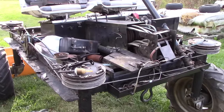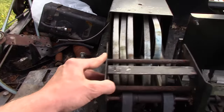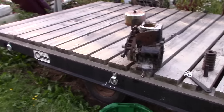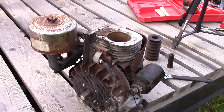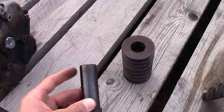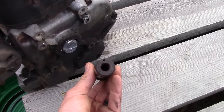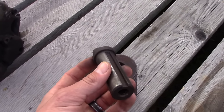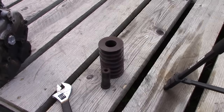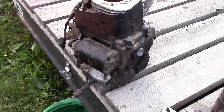Fast forward a couple days - you can see I've been busy at work on the quadractor. The engine has been liberated from the chassis and it's littered with mounting bolts and clutch assembly parts. The clutch assembly is dangling with six belts for the drive system. The engine had to come off because I think it's basically junk. I needed to get this drive pulley off, but I could not remove it for the life of me. I took it to a shop and they ended up torching the output shaft right off the engine - just blammo. They still had to set it on an anvil and drive it with a steel spike and an eight-pound sledge, one guy giving it all he had, quite a few strikes to get it free. It's unfortunate the output shaft got torched off, but I knew this engine was kind of junk in the first place.